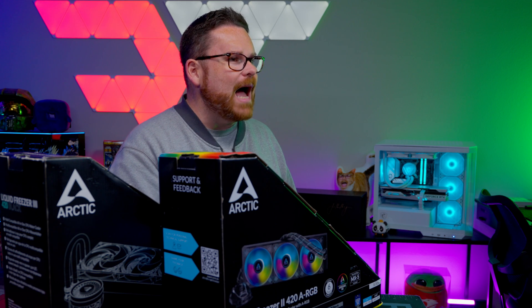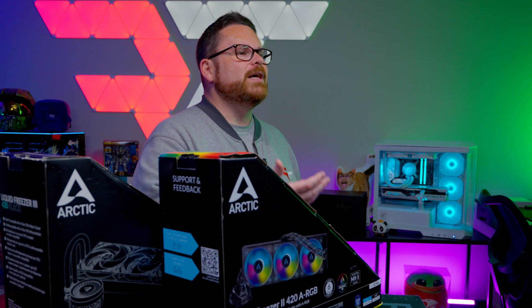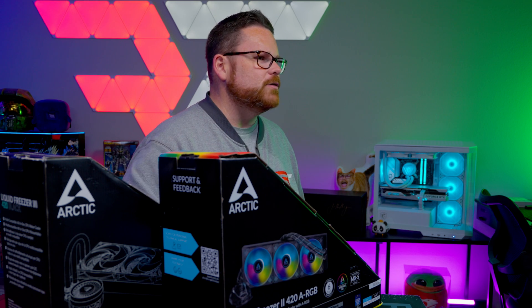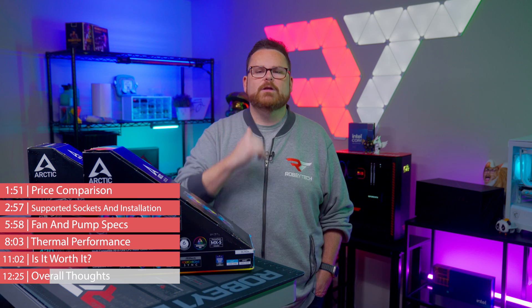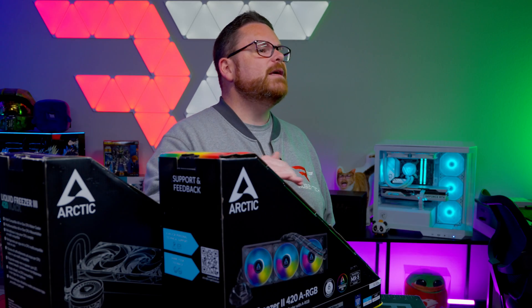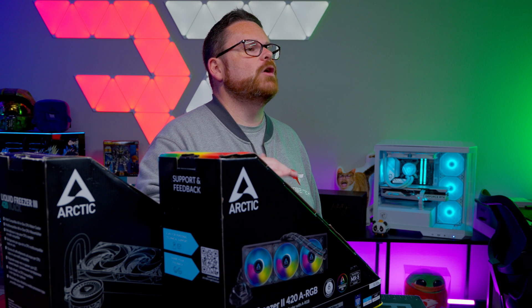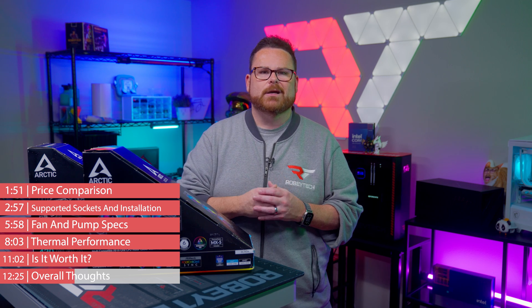The first concern is that newer builders, hearing about the hype and seeing the price, might make a purchase based solely on those two factors. If this is you, proceed with caution. Even if you're a seasoned veteran, know what you're getting into. We're no strangers to contact frames, but the margin of error goes up when you start taking apart your motherboard. Any missteps could be catastrophic to your motherboard, CPU socket, or the CPU itself. We have to count complexity of installation as a cost.